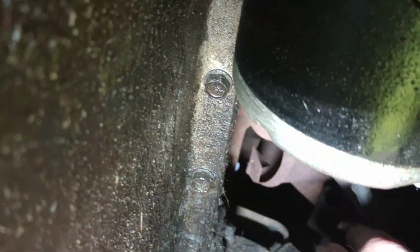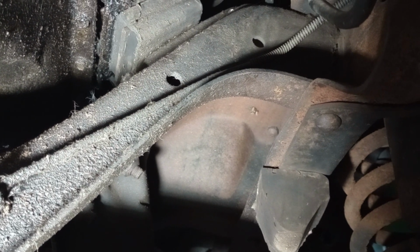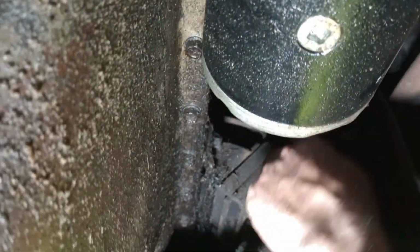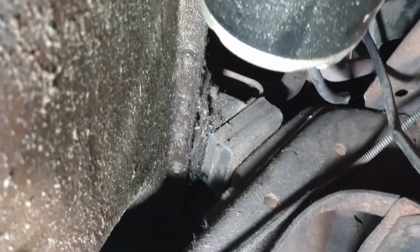This would generally have another segment that would come down, run along the exhaust and go. You're not going to be able to see it, but this truck does not have its catalytic converter or muffler on it. Okay, so that's the AIR tube there. There should be up there just below the smog pump somewhere.